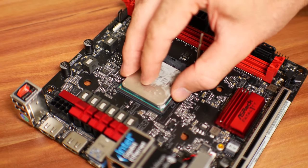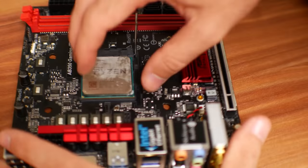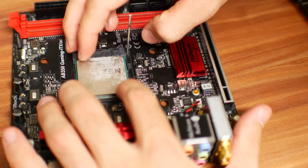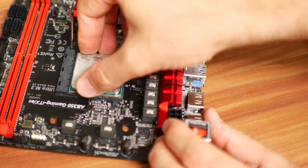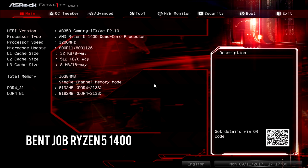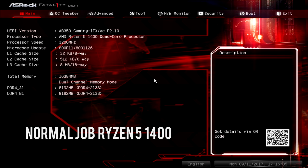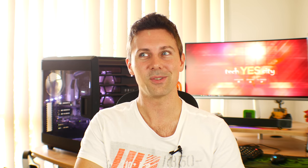I found that the mechanical screwdriver worked best for me — one with a very thin tip gives you a lot more control. If you've got better tools like fine tweezers, you'll probably have an easier time. When I installed the CPU, it did actually work. I booted up into the BIOS successfully, but one very odd thing with those two broken pins was that we were now running in single channel memory mode. I confirmed it wasn't the motherboard by installing a different Ryzen CPU.